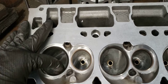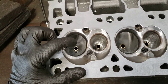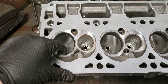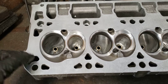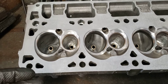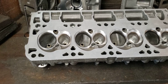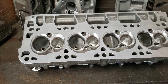Or you may dig into the pocket too far. Remember, we're just trying to get as much air out of this hole as possible into the cylinder. So if we have variations in where this all sits, it's going to change the way flow enters every single time. If we don't have the ability to change our program or to match the core shift by doing it by hand, the CNC machine simply can't compensate. What you either have is an undercut port, or a lot of manufacturers will just overcut the port to make sure they hit everything so that it looks pretty.